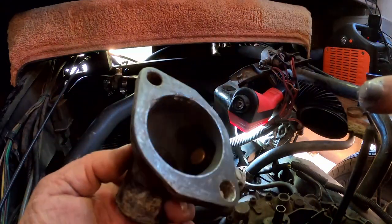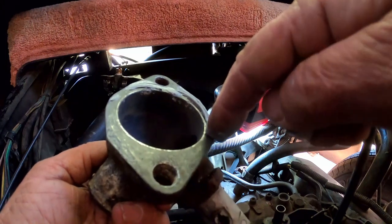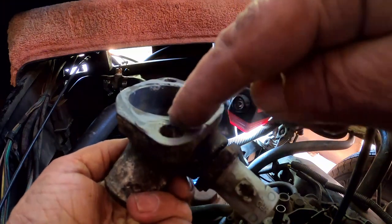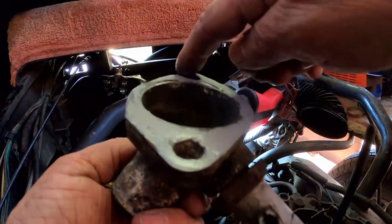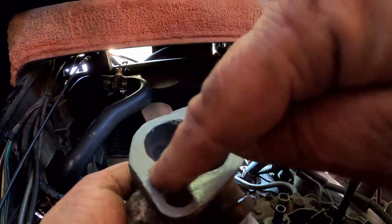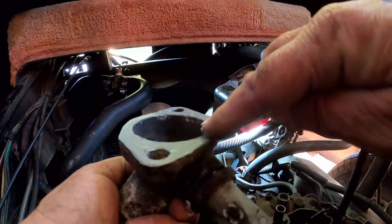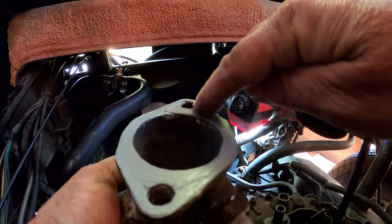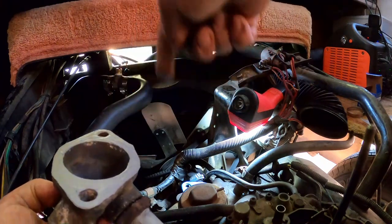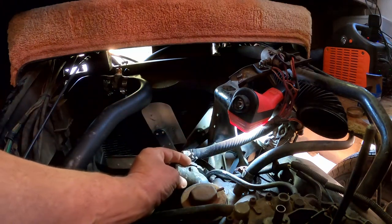This aluminum's been around. You know how aluminum and moisture can be. Aluminum can become a little pitted. We'll just go with pitted over time with moisture. Heck, you've seen aluminum wheels over a long period of time, a lot of exposure to moisture, especially chemicals like road salt. You see what can happen to aluminum over time with moisture. So we're just putting a nice thin coat the whole way around the housing. So we got a clean engine surface, some goop, a new gasket, some goop, and the aluminum housing. I'm going to set that on there, and then I'll grab the bolts.